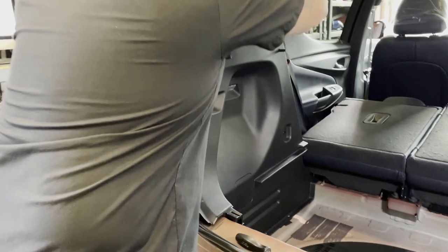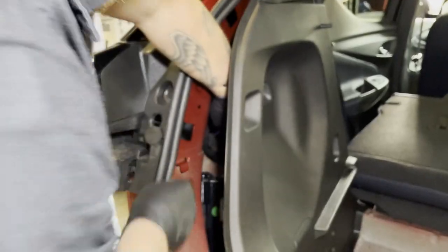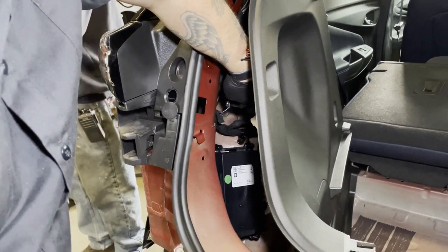Now that all of the electrical connections are made, install the 15-amp fuse in the holder. Check for proper operation of each signal at the trailer plug.